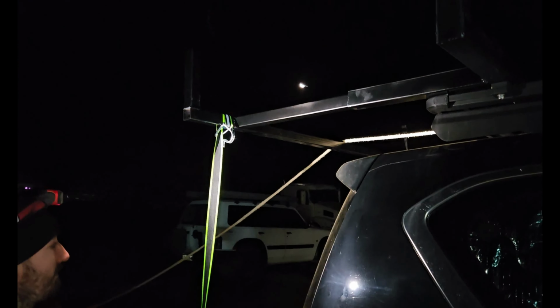And basically just made up this little H frame here. It goes in the tow bar. That's too high, that's too low. So as the boat comes up, this top of the hull is right at the top here. So I've got to cut that off and raise these so they sit about here. And I reckon we'll be right. This hook here, we've done around eBay. We've gone through the handles and back on itself, so it pulls from the center, and they actually work quite well. So that went up over the top there.